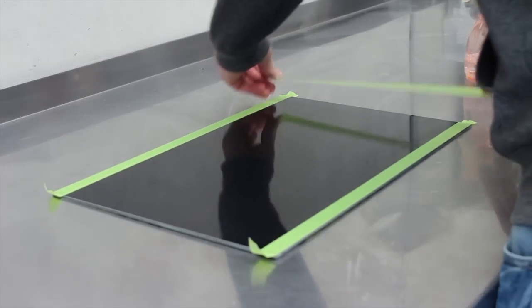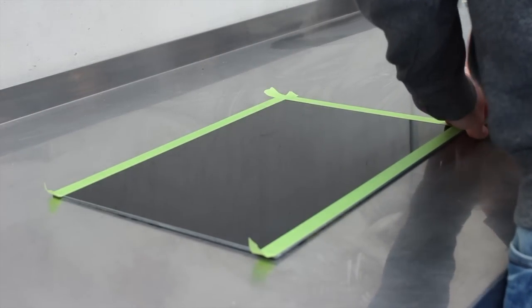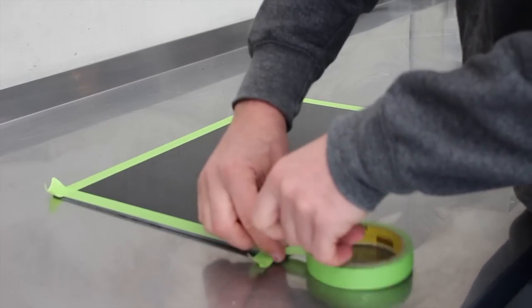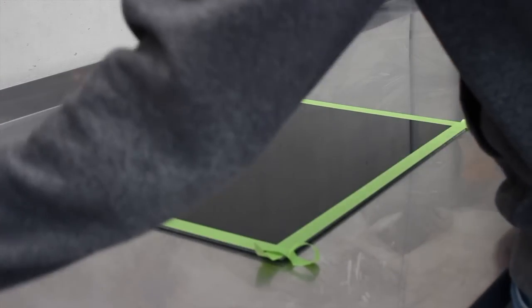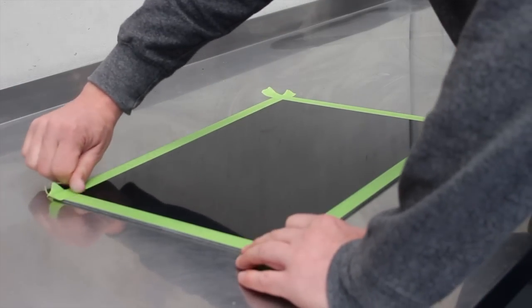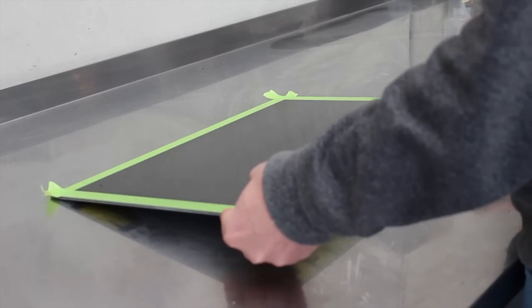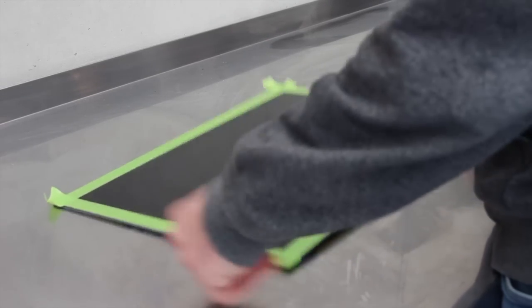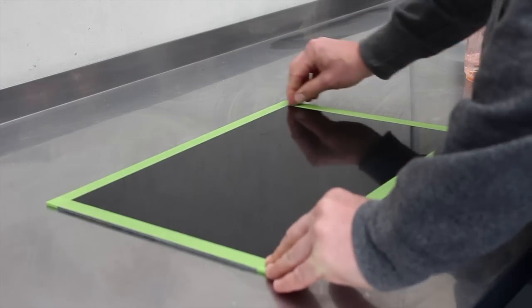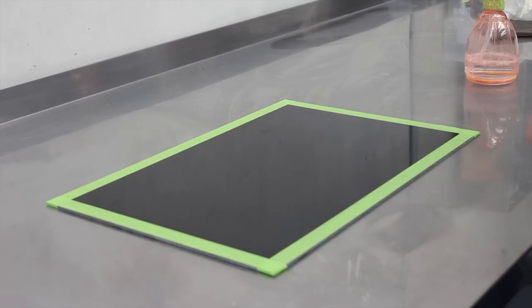You don't need to totally remove the shine — we just want to dull the surface and give it a bit of tooth. If this was an actual tank or helmet or any other automotive project for a client, I would prep it a little bit differently — probably use 800 or 1200 wet and dry sandpaper and make sure I totally sanded it flat. This is just a sample panel to show a customer, so we're not being 100% crucial.